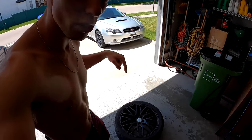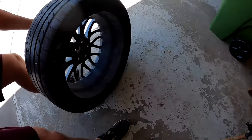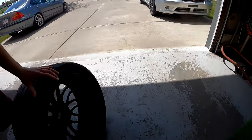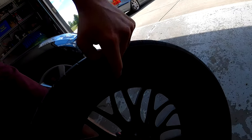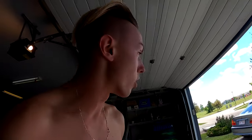What the hell is going on YouTube — today I'm showing you the easy way to fix a cracked rim. This rim is off of the old Legacy. There it is, make sure you see that on camera. What we're gonna do is get a wire brush and sand it down, then we're just gonna JB Weld it. This isn't gonna be the most professional way to do it, but this is how to stop a leak and provide a little bit of strength for that crack so it doesn't keep cracking.